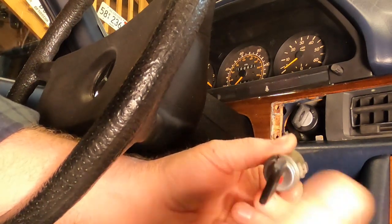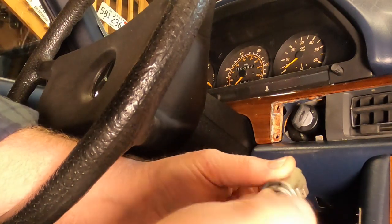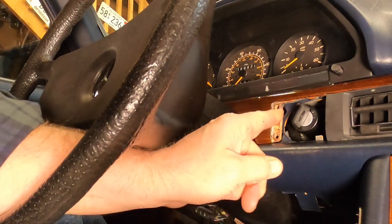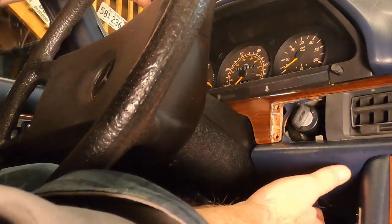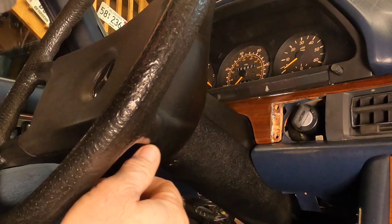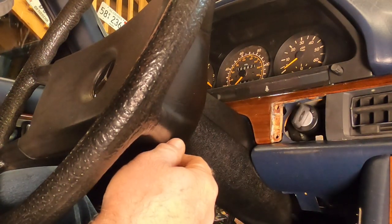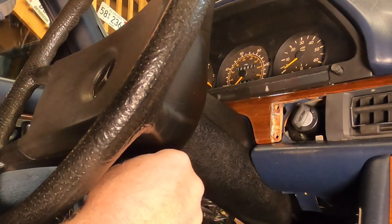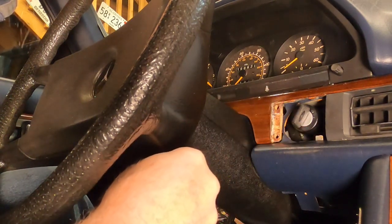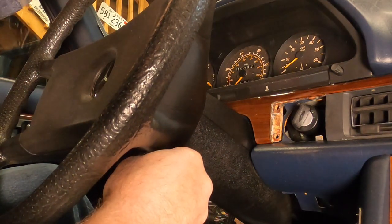I may have two problems. This thing is kind of rough to go in — you've got to push it past that — but once you get it in it works just fine. But I had to struggle to get it to turn just a minute ago. I think the issue is in the ignition switch up inside there, or the steering lock. I'm going to call this a win-loss — we went through the process of replacing the cylinder lock only to discover that wasn't our problem, which leads us to another issue in the next video. Thanks for stopping by the channel; don't forget to like, share, and subscribe, and click the bell to be notified when I really fix the problem.